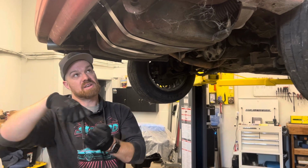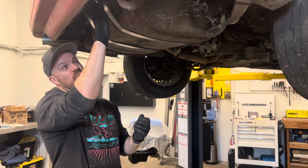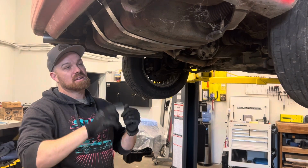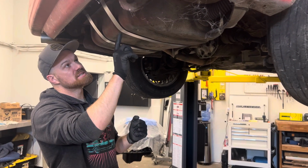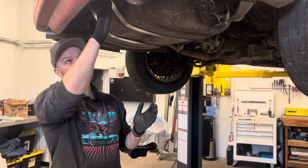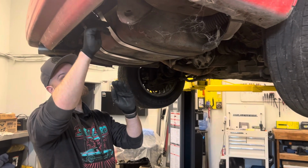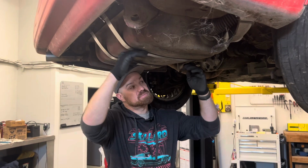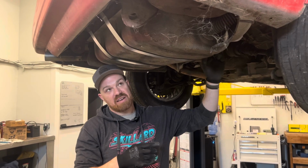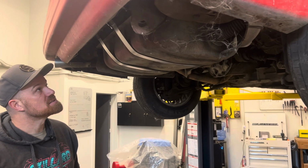Same thing with putting the new ones in, we had to do the same process. So when we put them in, the straps were bent the wrong way. But again, like I mentioned upstairs at the table, as long as you don't bend it to the point where you kink it, since they're stainless, they can flex back the opposite direction and then be bent back into place. We pulled it around, bent it mostly back by hand, and once we attached it and tightened down the bolts over here, it pulled up nice and snug against the tank, and you can see how they fit.